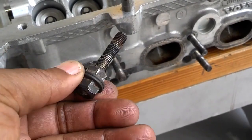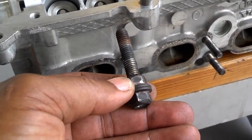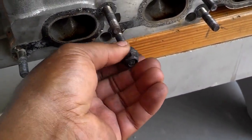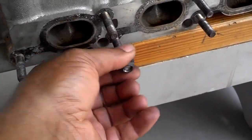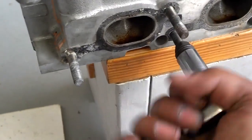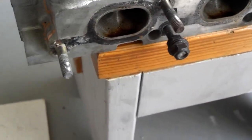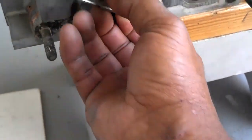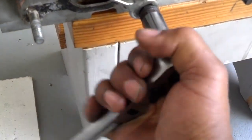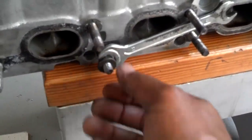After you get the bolt off the end of it, because you got this bolt sandwiched in here, the easiest way to get these two off is to screw this back in the head, tighten it up a little bit, and then pull these last two bolts off. I'm going to tighten this into the head until it stops. As soon as it stops, I put my little 13mm on here to stop that bolt, then I take this and back this out. I got the wrench on the inner bolt and then I take this outer bolt off.